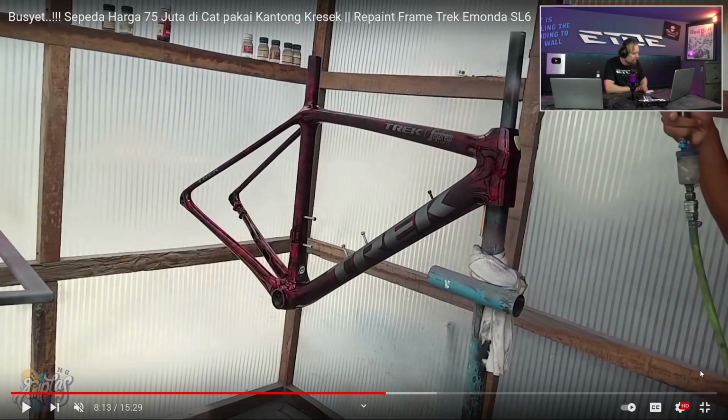Oh, stop again. Check the frame. Check his frame. He also sanded only the decals, not the complete frame. And that's not what a professional would do, because you risk that the next layer of clear coat will peel off and that there's no bond between these two layers. That's a high risk. I wouldn't do it, because if you have a client who likes to apply one of these protection foils on the frame, there's a risk that he will peel off